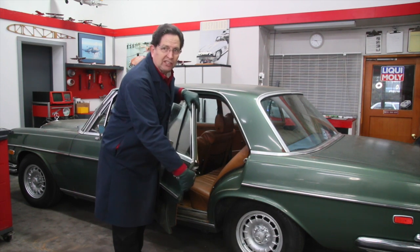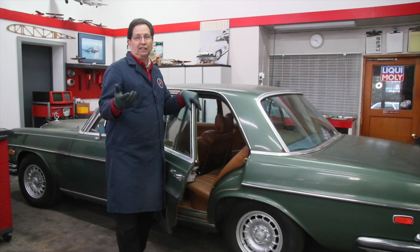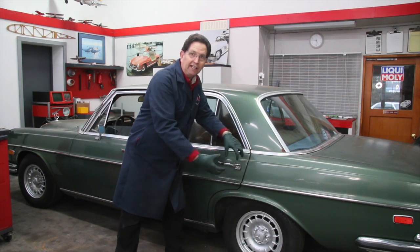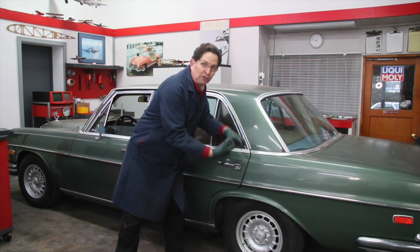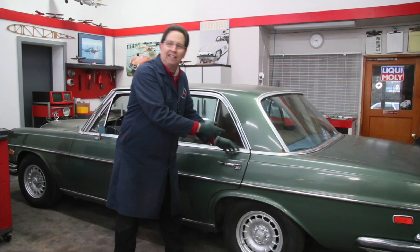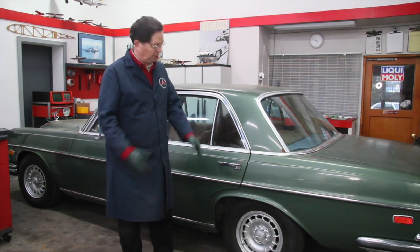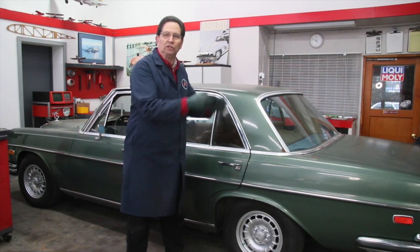But if the latch or catch assembly down here is jammed or stuck so it won't release, then you've got another problem. I had one guy tell me, Ken, I've had success. He explained it this way: I put a block of wood here and get a rivet gun or an air chisel up against this block of wood and try to vibrate this whole mechanism to shift the latch around inside and get it open. You might try that. I've never tried that, but I thought it was pretty clever, because I've used the vibration method before when I have a stuck tumbler in a key that won't turn. So maybe that would work on a door latch mechanism that was not coming loose inside.